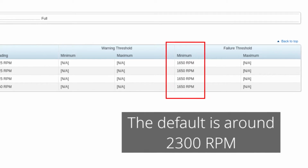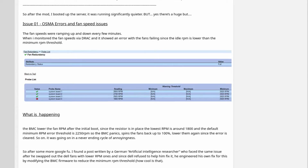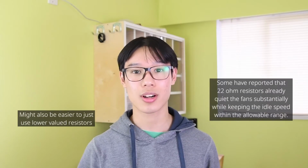Now there is one caveat with this mod. You do actually have to modify the firmware to reduce the minimum allowed fan speed. If you don't do this, the fans will periodically ramp up and down as the nominal voltage applied to them results in a speed that is too slow. This is apparently really annoying. I wouldn't really know myself though, because I've actually already modified the firmware on my machine several years ago. So I've linked some helpful guides in the description below if for some reason you still have a PowerEdge 2950 in 2023. I did briefly try this method on Fedora 38, but I wasn't able to get it working. You may have to use an older version of CentOS or something similar.